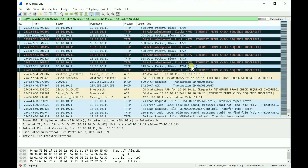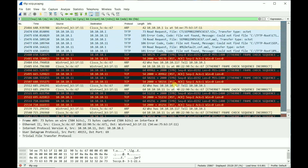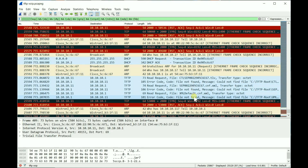Once it got the last file it needed, it rebooted. You can see the DHCP request and acknowledgement again, and then it started asking for the TFTP server again. After that, it tried to download its XML config files to find the Call Manager — I didn't have that set up since I just wanted to restore the firmware. But you can see the TFTP server needs those XML files to point the phone to the Call Manager. It came up and it worked, though it kept rebooting trying to find its XML files.